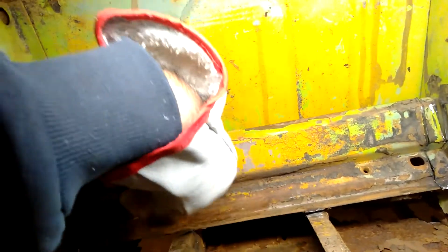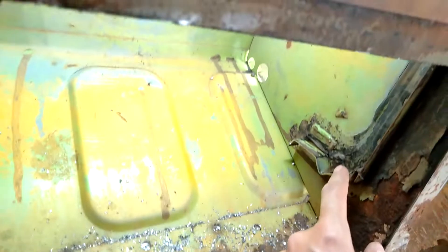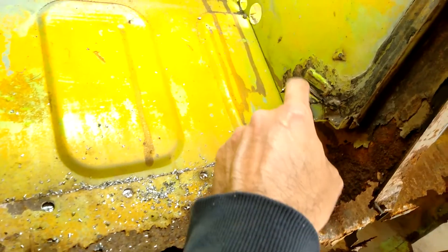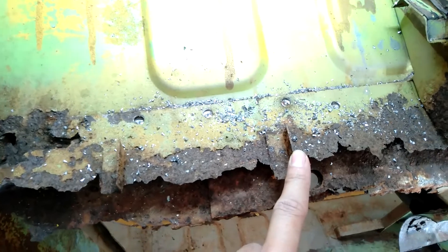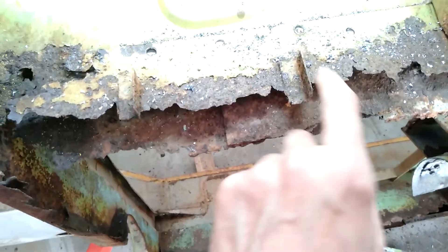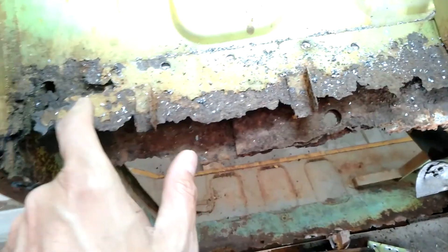I've removed all the floor out of that battery compartment. I've got to clean up these side bits - that's all got to be removed still. That's the edge of the main bracket that went across - like the little tray that everything lines up with - and there's another one on that side. These brackets are the actual end pieces of the floor supports and the spot welds have just broken loose. Now I just need to finish drilling out these spot welds and then remove the old piece of floor.